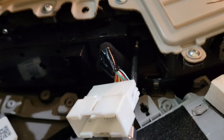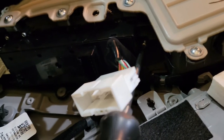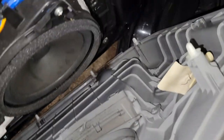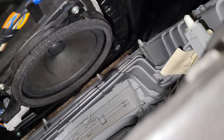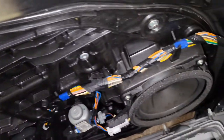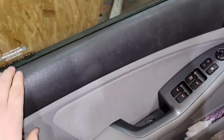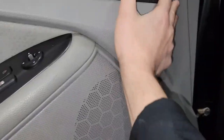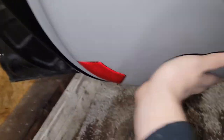Got it put back in — it's lit up nicely. Perfect. Put the screw hidden in the back back in, just because it's easier to get to. Once you get that bottom screw back in, put the wiring harnesses back together and just line up the holes at the bottom. It's not something you can do with one hand. Line up the holes, get that put back together, and get that top plate put back in. Start up here at the top and hang it, then everything else should pretty much line up. Give it a couple taps, make sure it's all in there properly.